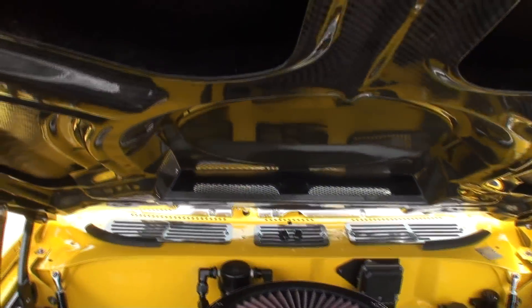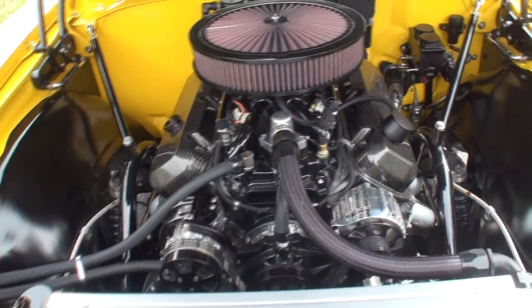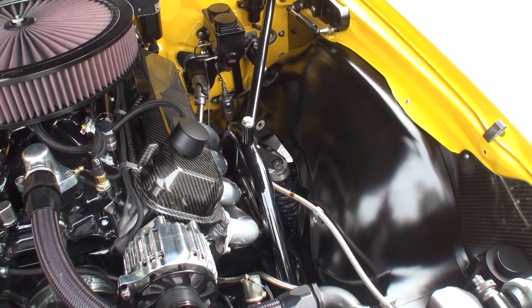This one has no chance of being a sleeper, even with the venting in the back for the cold air induction. When you hear this thing, it doesn't even idle functionally until about 2,300 RPM. When you're going down the highway you need to keep it around 2,200 to 2,500 RPM for everything to smooth out — it's got so much overlap in the camshaft. It will idle at a thousand RPM but it jumps around, and when you start driving you've got to keep it up a little bit.